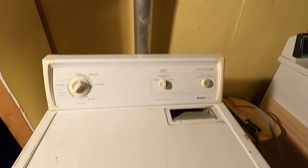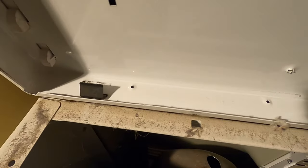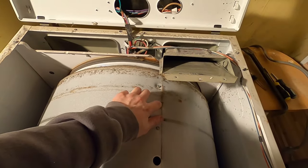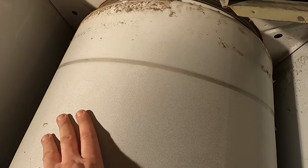With your power disconnected, you can carefully lift this up. It's on kind of like these little metal hinges and I'm just going to take this and rest it right here. Now this whole thing is exposed — you have your drum which you can see spins like this. Right off the bat I noticed something: there's no belt. You can see this little mark right here — that's where the belt's supposed to be. That's actually a good sign, because if the belt was attached and everything was fine, that would mean the motor was bad.